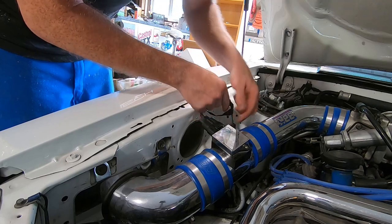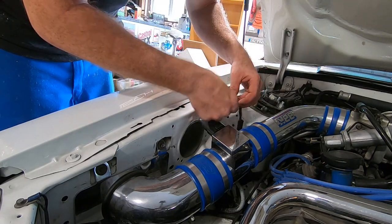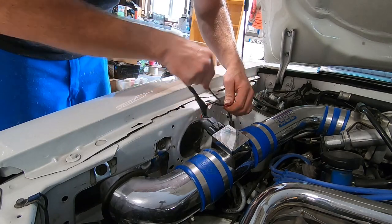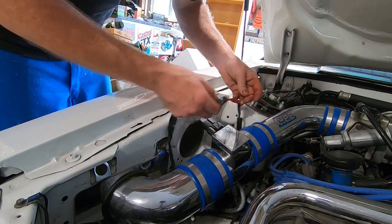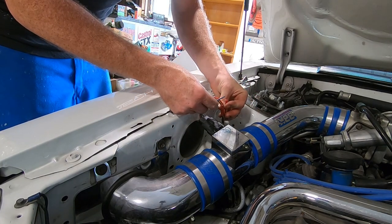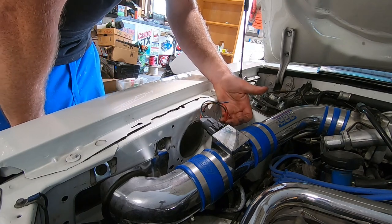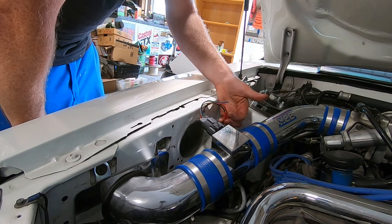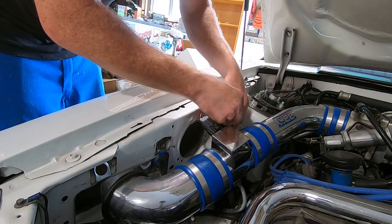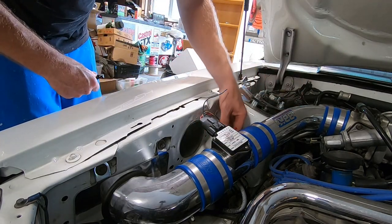Looking down here it looks like somebody has spliced the MAF connection, and I recently had an issue where one of the connectors slipped out — and would you look at that, there's our problem. We'll make sure all these connections are good. I can't even make this stuff up. I bet when I had the connector off it was just barely making contact. Without the MAF signal, the computer could potentially be throwing the O2 sensor codes and all those others we were getting. Let's hope we haven't been running really rich and blown out an O2 sensor — let's get this fixed up and put the proper MAF on.